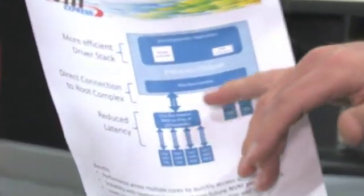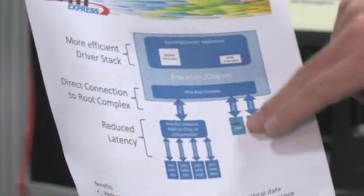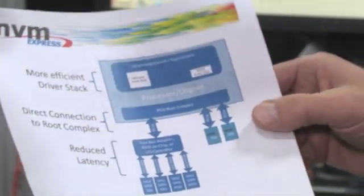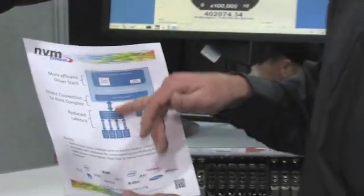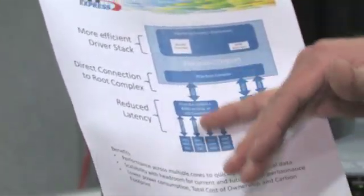It is storage — it's not a rotating hard disk. It's an SSD as opposed to a hard disk. NVM Express isn't just about connectivity; it's utilizing the PCI Express bus. The NVM Express connects directly into the PCI Express bus. As you can see in this picture, SATA and SAS traditionally connect through a controller to get to the PCI root complex. On an NVM Express SSD, it's connected directly — it has its own PCI Express controller built into it.